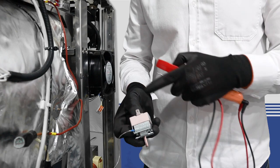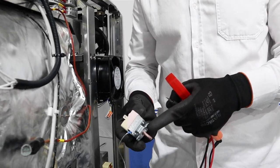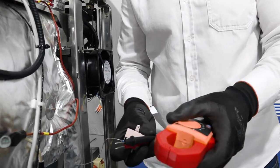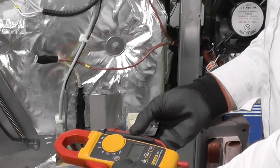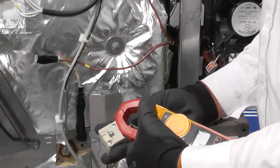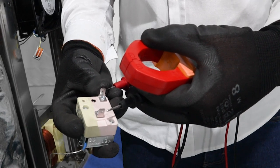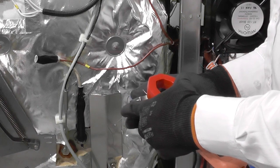For the next step, we're going to remove the cables from the thermostat and make sure that its pin is in the original position. We're going to check continuity between the two cables. We hold the thermostat, select the continuity test, and put one probe on each terminal. If the amp clamp beeps, the thermostat is working fine. If it doesn't, replace the thermostat — always making sure we didn't move the position of the pin.